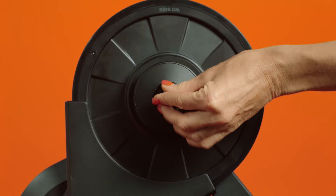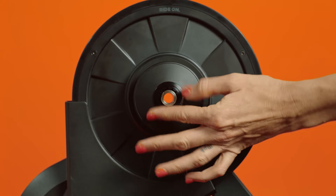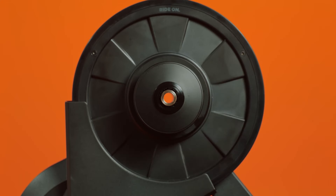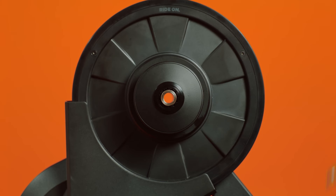Finally, it's time to replace the axle adapter that you removed. To start, screw it into place so it's finger tight. Finish by using the wrench or torque wrench — a quarter turn should do it. If you're using a torque wrench, tighten to six newton meters.